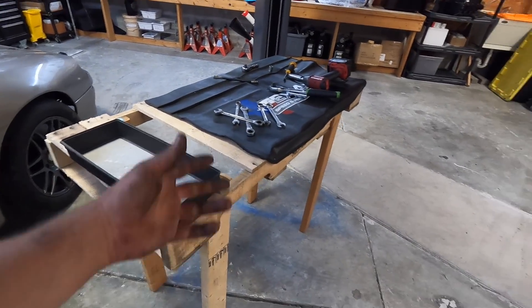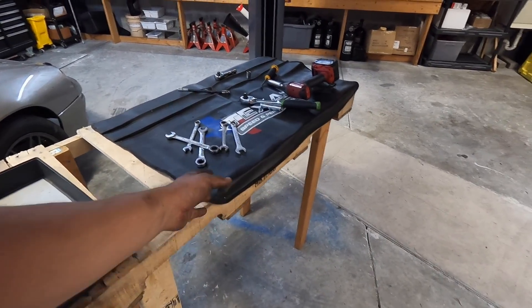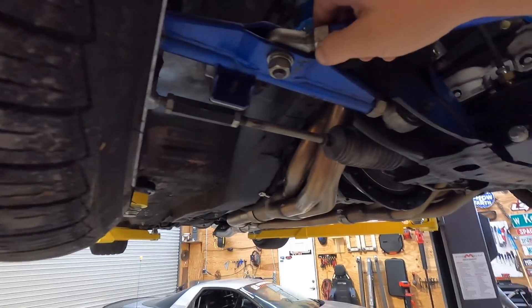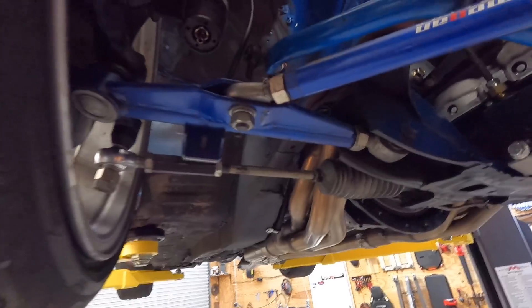Been using this makeshift pallet table as a kind of workbench — eventually I'll get one of those nice ones on wheels. The old free-99 one with the Texas Speed fender cover is doing its job. I don't use fender covers because none of my cars are nice enough. Fluids are back in, should be good to go. I've been tying up odds and ends — added a couple P-clips to the fuel lines to keep them from bouncing around and hitting the exhaust. Did a quick nut and bolt check on everything. Looking at alignment stuff but honestly everything on this is so old and corroded you basically can't loosen or tighten anything — these heims are just beyond repair in a lot of ways.